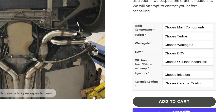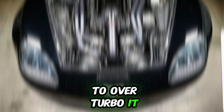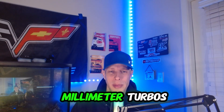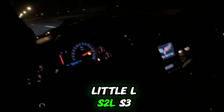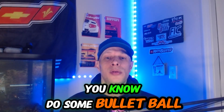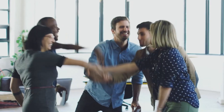When looking at turbo sizes, I would not go smaller than about 62 millimeter. You don't want to over-turbo it. If you're running a twin turbo kit on an LS2 or LS3, I probably wouldn't run 76mm turbos. If you've got a Z06 with the 427, you've got a beast of a motor, but for a smaller LS2 or LS3, I'd probably do 68mm, maybe even 62mm — some billet ball bearing turbos so they spool up super quickly.